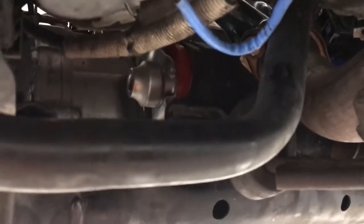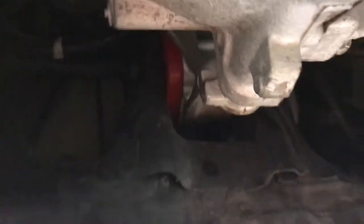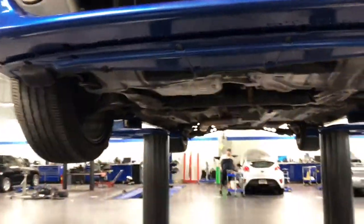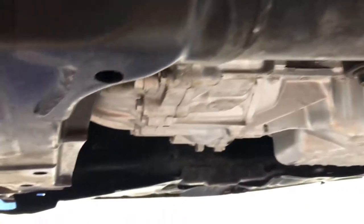When I did my clutch job I put in these Energy Suspension motor mount inserts. They are pretty stiff — they basically transfer every bit of vibration from the motor into the cabin. But they work very well. I'm eventually going to get better motor mounts because the back one was shot. It kept lunging forward every time I shifted out of third — I felt like it was hurting the transmission because I could feel it thunk. These things are like $27.